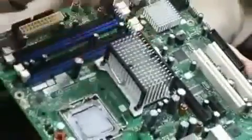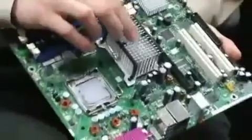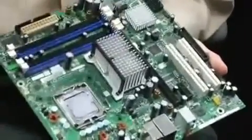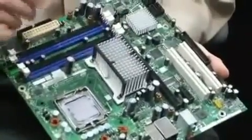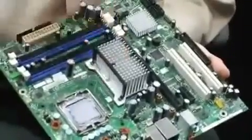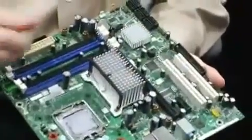So what's special about vPro and AMT? Well, in addition to this big processor, there's a small processor in here. It's a very small, 8-bit processor — it's not that fast, it's very low power. But this little processor can stay on even if the computer is off. As long as the computer is plugged in, even if it looks like it's off, there's still a little bit of power being used to power this tiny processor. We call this the management engine — it's a management processor right here in the ICH chip, and it talks to the network card. You can talk to this little processor even if the computer is off.